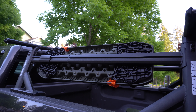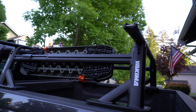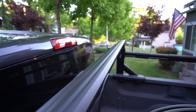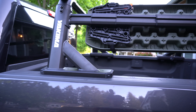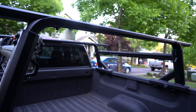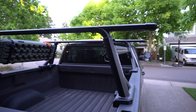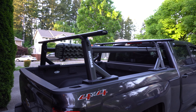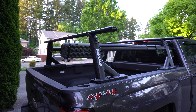The first pro is that it's actually very easy to install. It does not take a genius to do it, and it comes with all the tools necessary to do so, minus a flashlight and a tape measure. It's extendable — at least mine is — so I can raise the height higher and lower, which makes it very versatile for carrying lumber, a rooftop tent, or anything else you plan to use it for. It's rapidly removed — all you have to do is loosen four screws on each base mount and the whole thing will come off. This can be done with one person, however it is a lot easier with two. The other true benefit is that it is lockable to the truck. Two of the base mounts have a locking mechanism, though I honestly would prefer that all four base mounts have it.